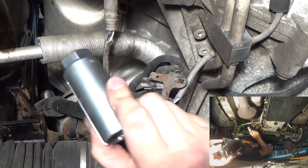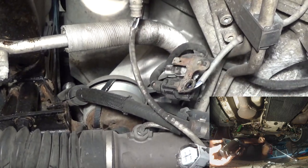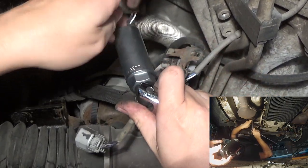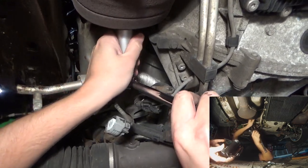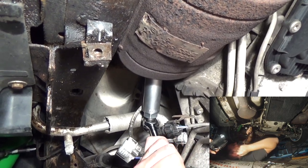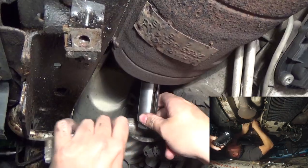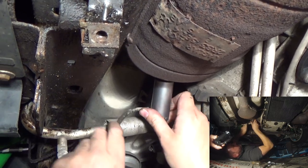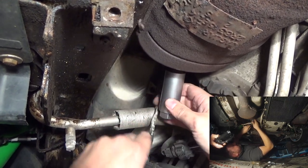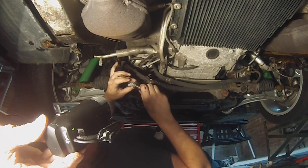You can use this — we've got a removal tool here which is 22mm. Get that on there snug. Okay, just breaking that joint is the worst bit; once it's broken it's fine. I think the tool we've got is actually just slightly bigger than 22mm, so when you put a lot of strain on it, it actually jams on the sensor. That's the old one out — remove that.